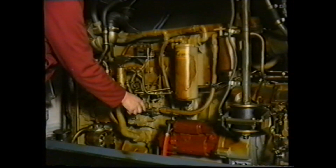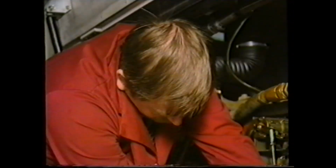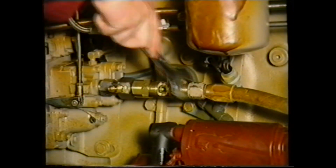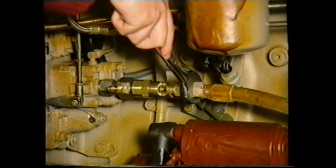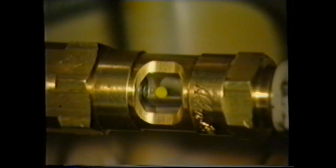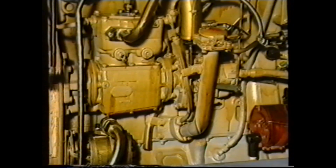Providing all is in order, a check should be made for air in the fuel. To do this, install a sight glass between the pump and filter. Once again, crank the engine. If fuel aeration is not visible in the sight glass and there is little or no fuel movement, you should proceed to cover this drain hole up on the pump drive housing.